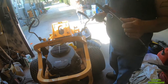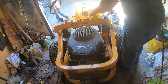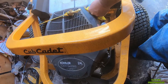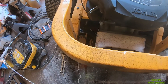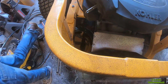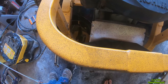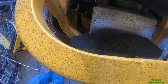If you have compressed air, just put the nozzle in the tilt tube, run over it, give it just a little bit of air, and it'll pump all the oil out of there — otherwise it just comes out as a slow dribble. Don't go too high on the air pressure or you'll blow the gaskets out of it.